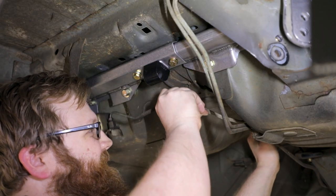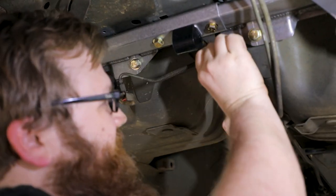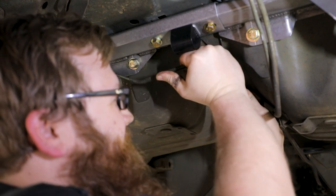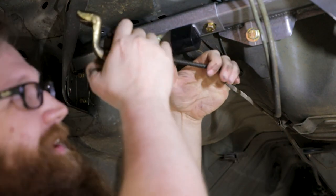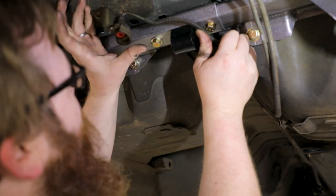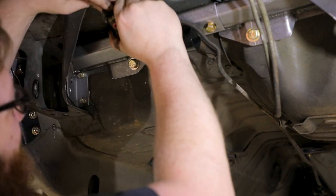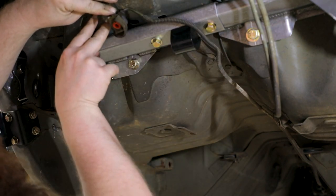Carefully remold the brake lines around the EXO brace so that the brake line bracket locates just rearward of the factory position. Use two of the provided 1/4-inch by 1-inch long self-tapping screws to mount it in a new position. If the brake line has corrosion, it may need to be replaced because it will likely crack at this step. Check closely for leaks and cracks.